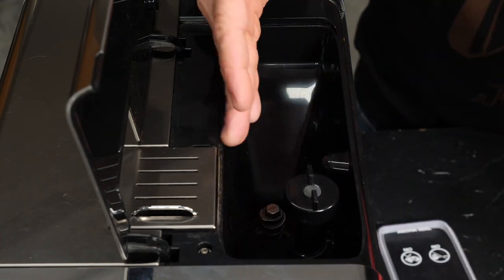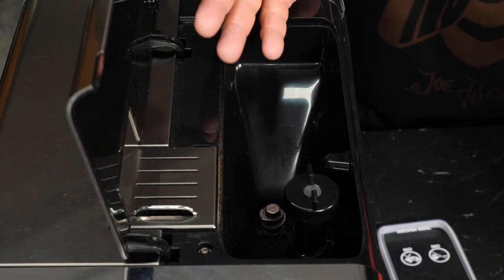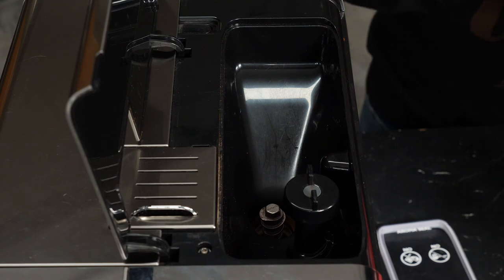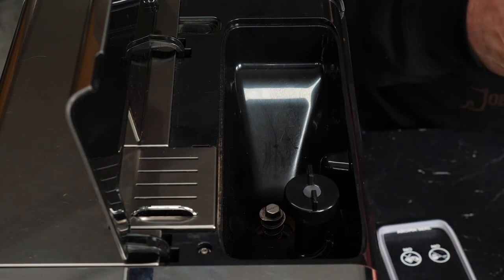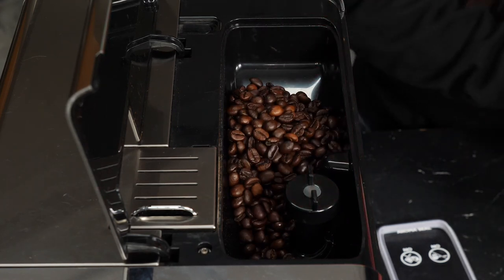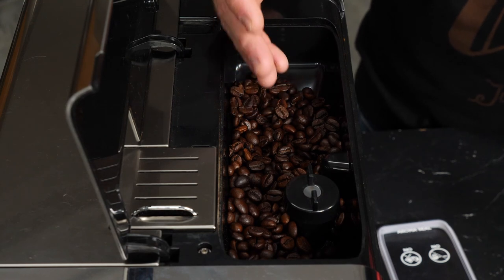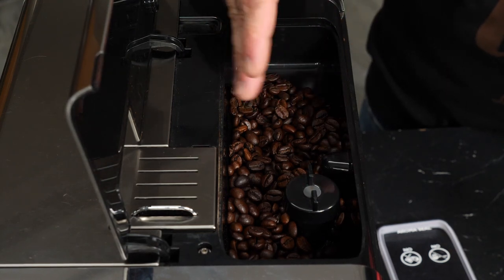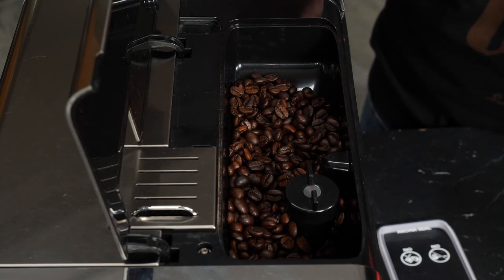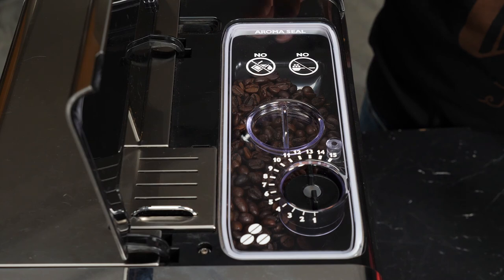That's why you should always adjust your grinder before adding coffee. We'll remove the lid and inside you can see the hopper and an auger which pulls the coffee down into the burrs. The beans you use should be a medium roast that does not have a lot of surface oil. Something like the Gaggia 100% Arabica is a good example — a nice medium roast with no surface oils or glossy sheen. Those oils can gum up the hopper and the brew group and cause damage. So no extra-dark roasts and no flavored coffee, and otherwise you'll be good to brew with the Babila. That puts a lid on it — we'll take a look at brewing next.